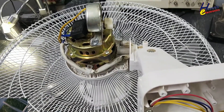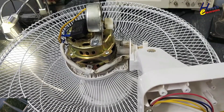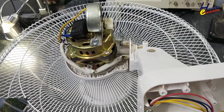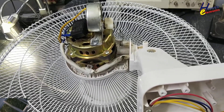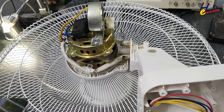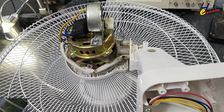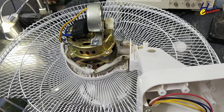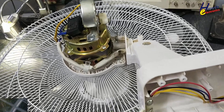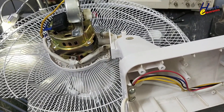The problem was the fuse. It is now best practice to install the thermal fuse so that in the next overheat condition it will remain safe. Otherwise, if it reaches over-temperature, the complete fan motor will be damaged. If you enjoyed this troubleshooting process, give a thumbs up. If you have any questions, please write in the comments. Thanks for watching.